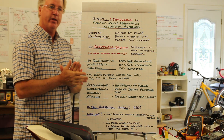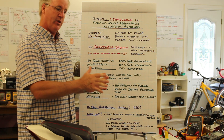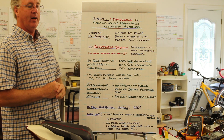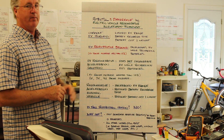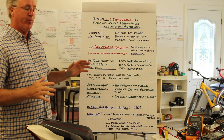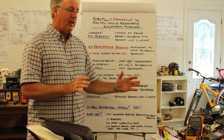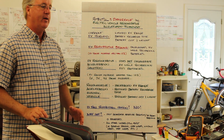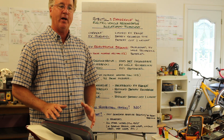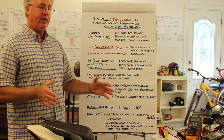Current problems with electric vehicles as they exist today include limited EV range, which is dictated by the size of the battery pack in the EV, battery recharge time, and the battery cost and weight added to the electric vehicle. EV regenerative braking currently exists in electric vehicles — that's when the electric vehicle's motor is used as a generator to decelerate and recharge the EV's batteries, and in the process of recharging the batteries, the generator decelerates the EV.